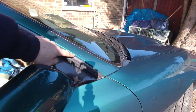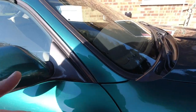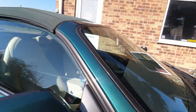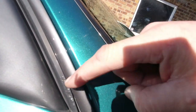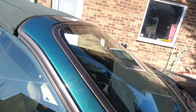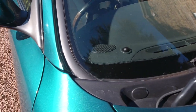The integrated gutter and trim around the tops of the windows are equally susceptible to this problem but even more of a challenge to replace, particularly on a coupe — that's a very long curved piece. On a convertible it's very short. You can see on mine the corrosion coming up underneath the rubberized area and pushing itself away. At the top of my windscreen you can also see corrosion starting to push the little rubber seal lip out.